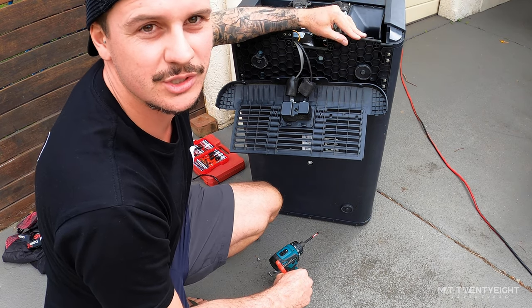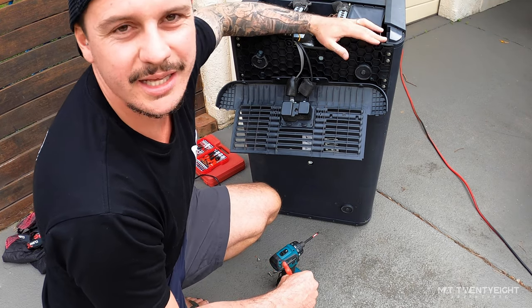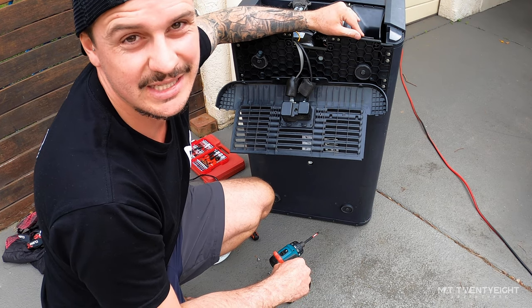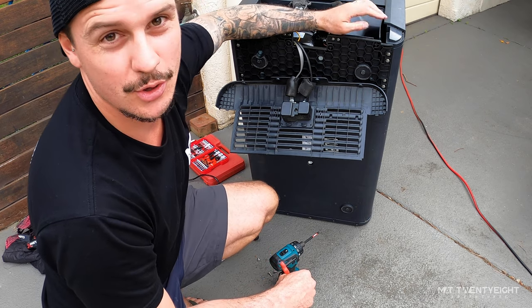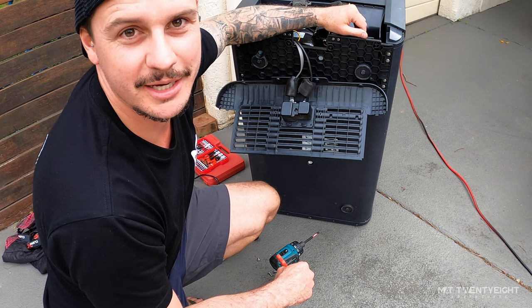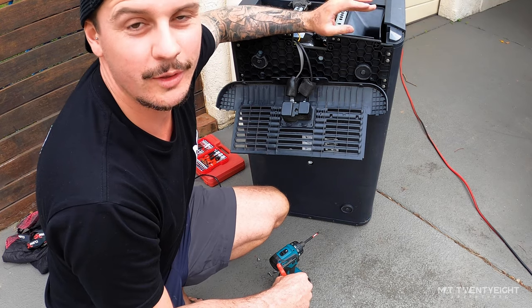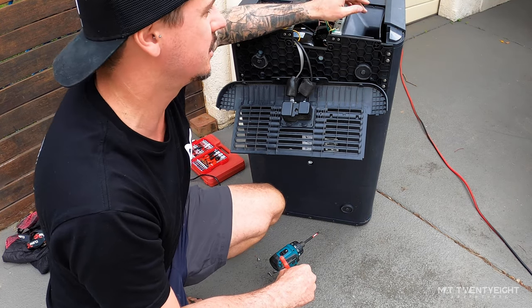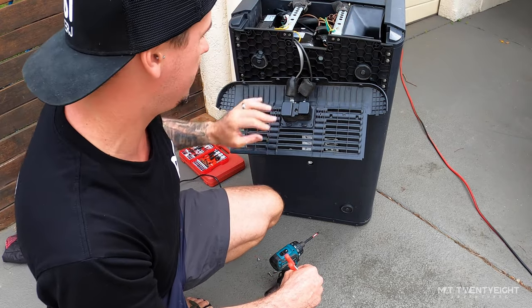It's a $2,000 fridge — I don't want to just buy a new one. I wanted to get it done. So it cost me 90 bucks for the thermistors, which is dear. You can get them online much cheaper. And then that heat paste was 13 bucks — if you've got a problem, I'll send that heat paste to you, I'm not going to use it all. I'm being hopeful that this all works, but it wasn't too bad to replace the thermistors — or thermistors they're called. Let's get this back on and see how we go.